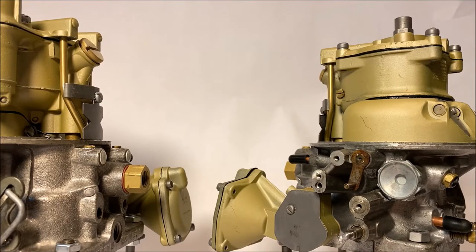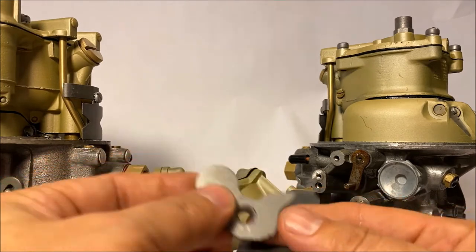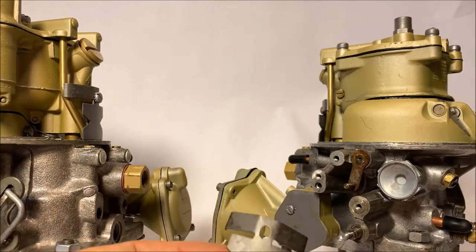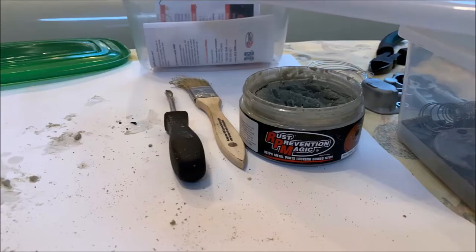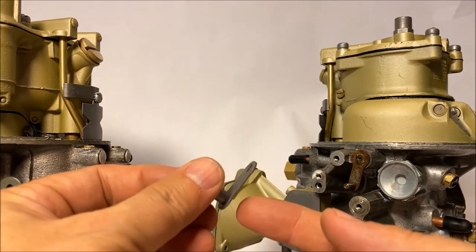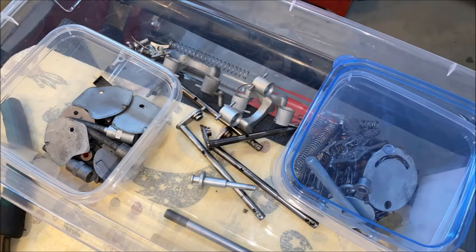Just to prep the parts for these particular carburetors — there's so much that can swap. For instance, these secondary diaphragms will fit three or four different years, and the air horns and so on. I highly recommend using this product — Carb Renew 2. It says bronze but it really looks green in the right kind of light. For the other small parts like choke plates and pieces of hardware that go on the linkage, and covers for the secondary tubes — even small wire linkage pieces — Rust Prevention Magic works very well with these particular parts.